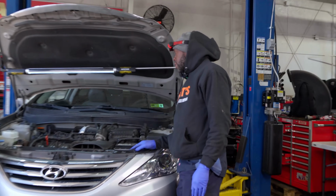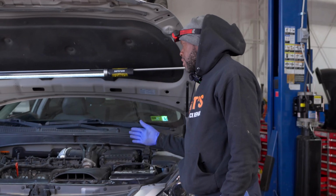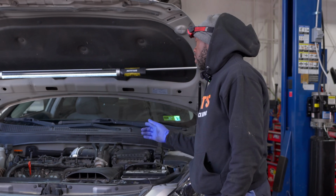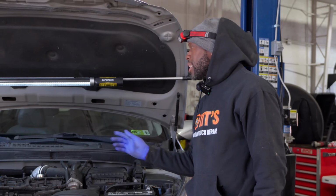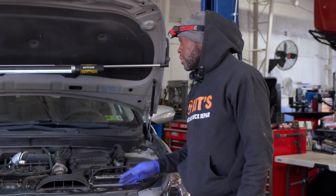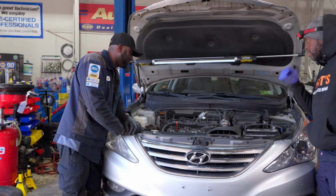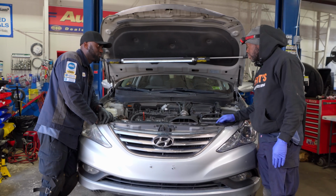So what I did, I realized the customer has a misfire. Check the car, find out the cylinder number 3 and 4. I rotate the ignition coil pack from 3 to 1. It still remains at 1. So that's what I've done so far. And you also did a power balance test with your scan tool? No, I did not do it yet. You didn't do that? Okay.